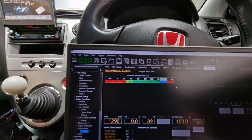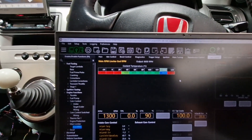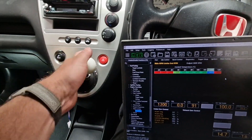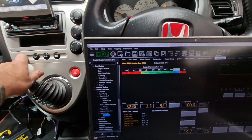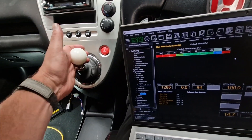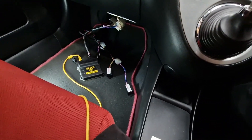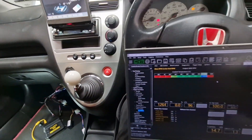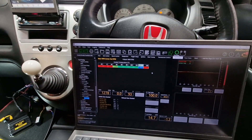We've got full logging functionality — I think we can log up to 10 channels on this. We can configure it with a wideband as well, though we haven't got a wideband on this car as it's a standard car at the moment. We've got the reverse lockout module on it — at the moment it will go right across, but as soon as we're over 20 kilometres per hour, that's stopped, so it won't go over. The base kits will come out without that and you can have a switch instead, because a lot of people with K-swaps might be running five-speed boxes or race cars and are used to running a switch for that.